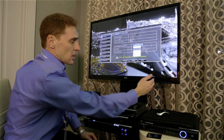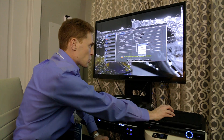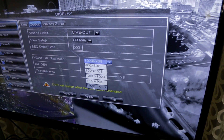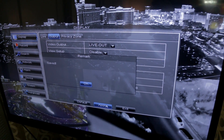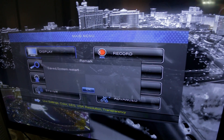I know that I'm connected to a 1080p high-definition TV, so I can select the maximum output resolution, which is HDMI resolution 1080p. I select that resolution, click Apply, it saves the settings, and I'll exit.